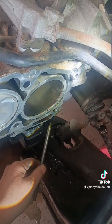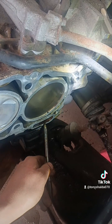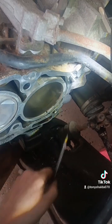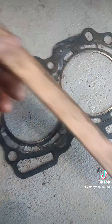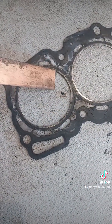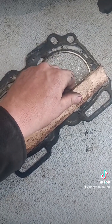The best clue of why they leak is where they leak. It usually starts down here at this oil port with a little bit of seepage, and it doesn't always get worse — this can go on unnoticed for a long time, or it can be dismissed as a leaking valve cover gasket. Then we blow a compression seal. Why does it always happen in that order? When you bolt something down, the force on whatever you bolted is greatest near the bolt and gets lesser the further from the bolt you get. When you put two bolts in, the force is greatest between the two bolts. The head gasket shows how the head's bolted down — you have bolt holes and a line of force between them. All the lines of force intersect around the combustion chamber, because it needs that force right there. But look what falls outside the line of force — it's our oil jackets that always leak.